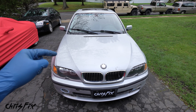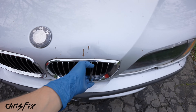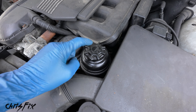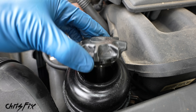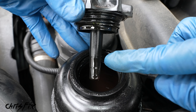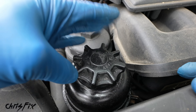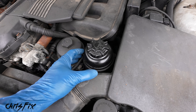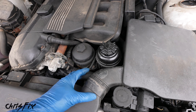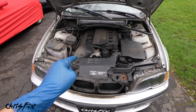If you think you have a power steering issue because you hear noise or your steering is difficult, before you assume it's a bad power steering pump, the very first thing you should do is check the power steering fluid. Locate the power steering fluid reservoir, unscrew the cap and check the fluid level. You can see we have fluid filled all the way up to the fill line, so this is unfortunately not our problem. A lot of times it's not the pump — it could be a leak from the reservoir or a line you could easily replace.